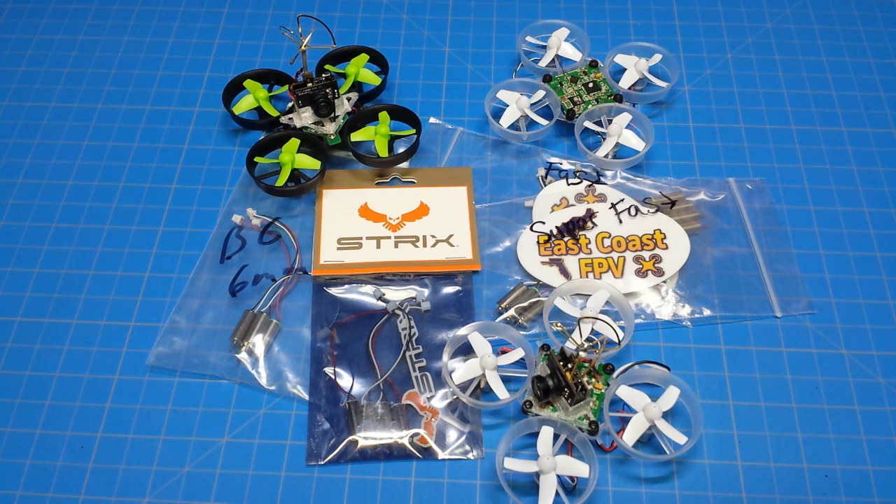I've received a lot of different comments on testing methodologies, but I think I have to stay the same. Otherwise I have to go back and test all those other motors, or those results aren't any good, or these results are different so people can't weigh them. So we're going to stay the same. We're going to do things with the trusty scale, some blue tack to stick things down, and we're going to run them up to full throttle. I'm going to do a human five count and then put on screen the highest possible number recorded. Keep in mind that is possibly a very temporary number, and I do a five second count so that you can do your own analysis. This isn't a longevity test, it's not a durability test — it is just a maximum thrust test.